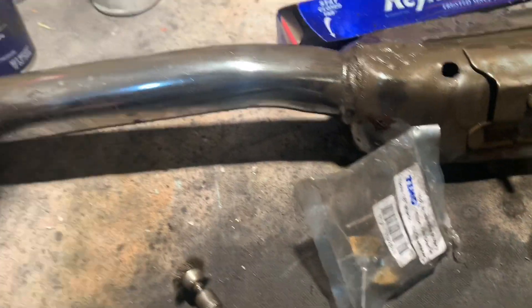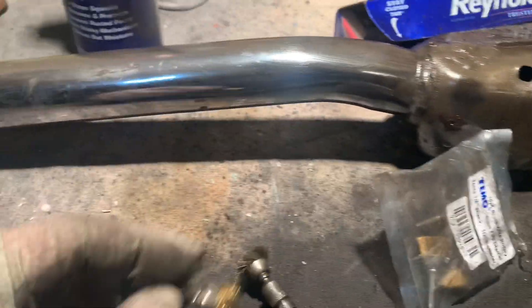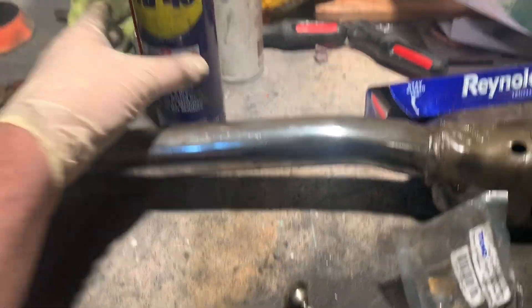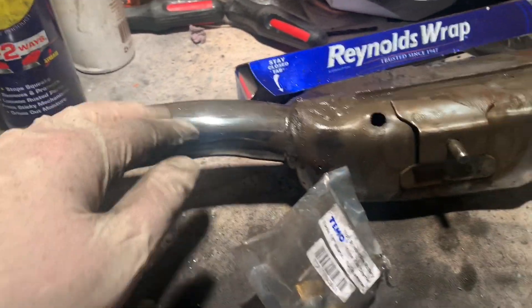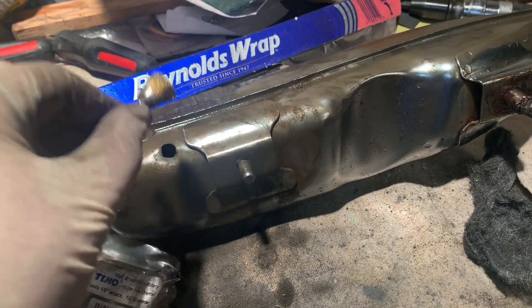So right now I'm just doing WD-40 and going around with my Dremel cleaning all of this up. To summarize the steps: aluminum foil and water for a big first pass to knock the heavy stuff out; WD-40 and steel wool for the larger areas; and then for the trouble spots, these Dremel brass brushes are a lifesaver — they're just cleaning stuff up really, really well.